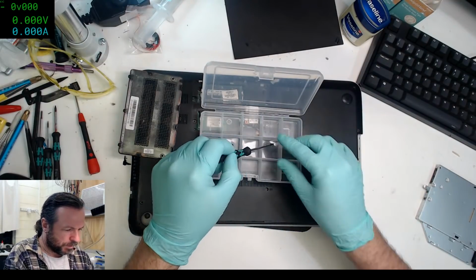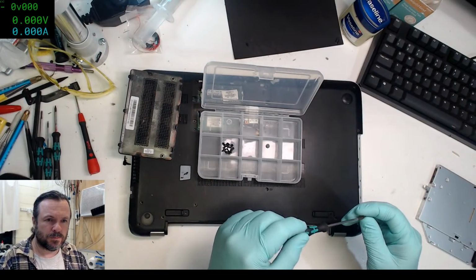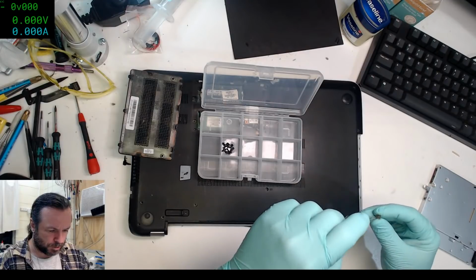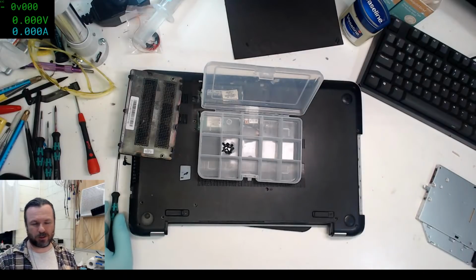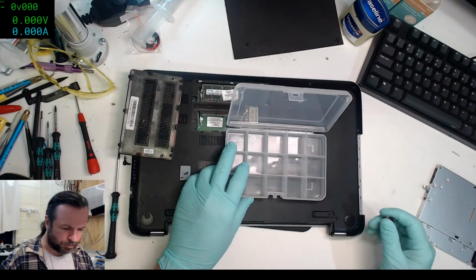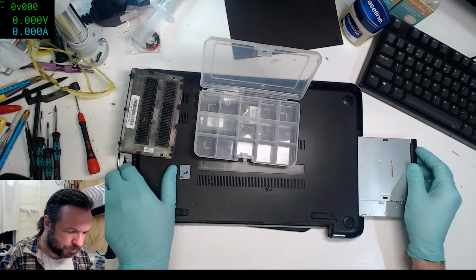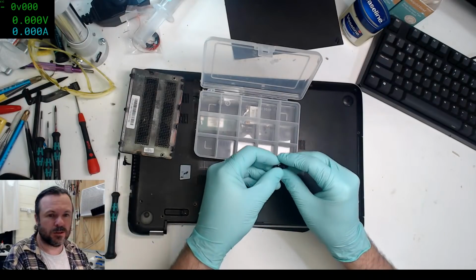Yeah, we almost forgot to put these flat screws in. Christian, what's happening to the phone is that it's trying to do an Android update, an OS update, I think. It boots and says optimizing applications, goes up to like 66 applications, and then it reboots, and it just keeps doing that non-stop. So there's something amiss with the user partition. Perhaps it's out of space. I don't know for sure.